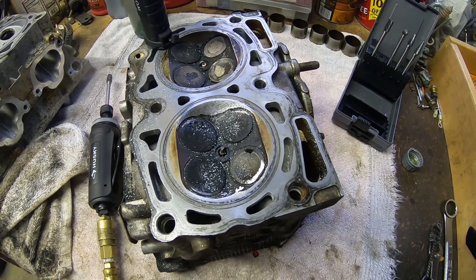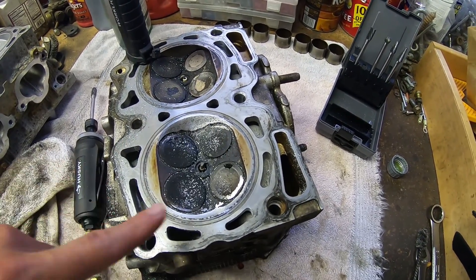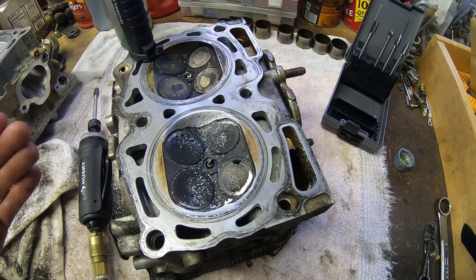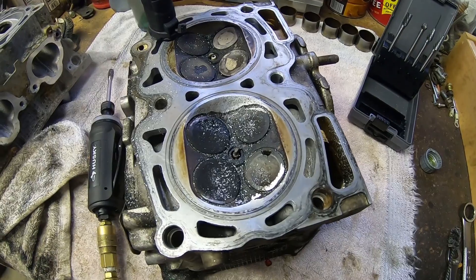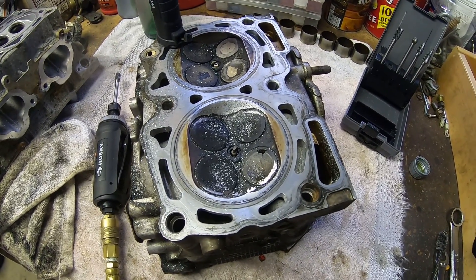I want to keep the compression ratio as high as possible, so I don't want to take out that much material. I want to take out enough to take off the sharp edge and the overhanging material, but I don't want to take out so much that I'm dropping the compression ratio significantly. I got my cool glasses today — this is day two. I kind of knocked off early yesterday.